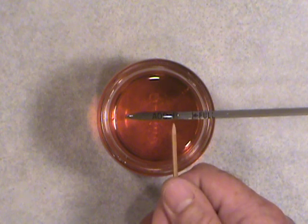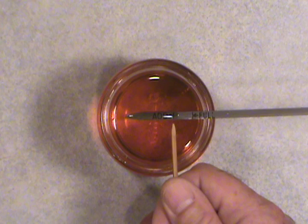I like to use the thickest oil that I can and still be able to start it in the winter when it's cold, because the oil thickens up when the engine's not running. Okay, so now we're at the add mark.